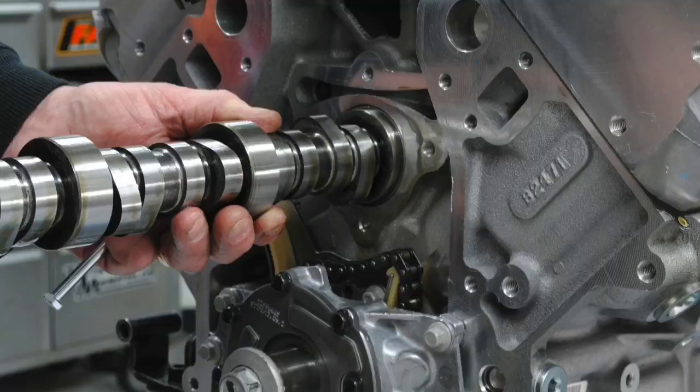Here's something important: not only is the combination critical, but you also need to look at the camshaft. If you have a cylinder head that flows 400 CFM at 0.800" lift but you have a 0.600" lift cam, that doesn't make any difference — you need to look at the airflow at 0.600" lift. Whatever that is, multiply that by 2, not the big flow number you're never going to use because you don't have enough camshaft. Apply this formula correctly knowing it's the potential of the head — you need the right combination, the right cam lift; all of that has to work.